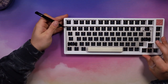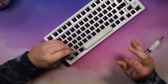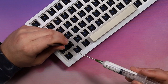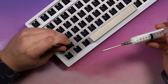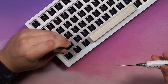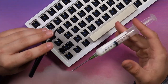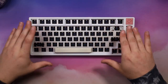How I go about this - I'm going to try to get this on camera. I pick it up with the tweezers. Don't pull it up all the way to where it can't move anymore - I go just before that, all the way up and then just a little bit down, so I can get the syringe in really well. Wherever the wire is, that's where you put it in - don't do the other side. Pick it up, right before the end of it, stick it inside, and let loose. Give it some of that lube - don't do too much, just enough. Then work the stabilizer up and down to make sure it's all in there. One thing: whenever you put keycaps on, sometimes it can feel over lubed, but just give it some time - it'll work itself out.